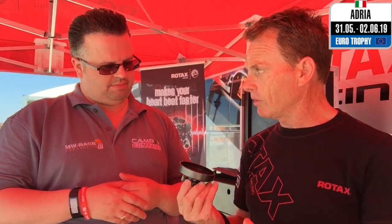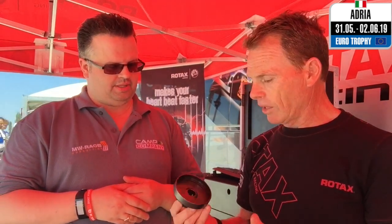Once again, at a certain RPM it opens up, it engages with the external cover, or the outer gear on the DD2, but because it's encased within the gearbox, it's running in oil, and a certain amount of oil is going to be within that. As you can imagine, a bit of oil means a bit of slippage here as well. So it's a different concept. We actually have a drive coupling on the axle compared to the Senior Max, Junior, Micro and Mini. But that's the operation.